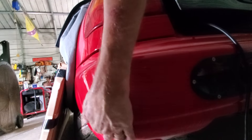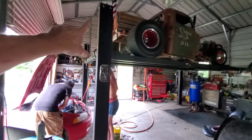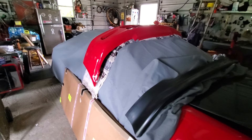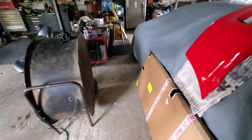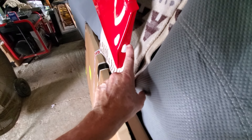Something really bad happened — there are three bad gouges right here on my rear bumper. When I lowered the lift I didn't know the ramp plates were standing straight up leaning against it, and they drove right into my rear bumper and scratched the paint. I'm gonna block-sand that with like 2000-grit, clear it, and buff it out — it'll be alright. And these little spots here — Jeff told me that's where it was hung, and it's on both sides.